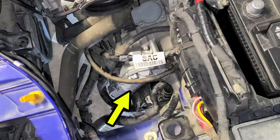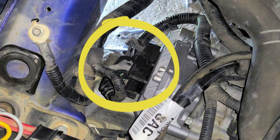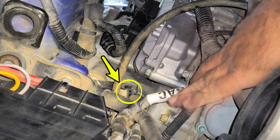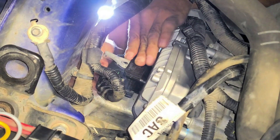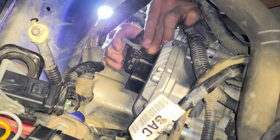Now I have access to the TCM, which is located right here. Circled here are the two wire harness connections that will need to be unplugged from this module. Here's a look at the same connections from the bottom side of the engine. Because this car is very low to the ground, I did go ahead and park it on a set of ramps so I can access the bottom of the engine as well, which makes this job easier. Before unplugging these, there are a couple of spots where the wires will need to be pulled loose as shown here highlighted with the arrows. There are also some tubes at the bottom and top that will need to be pulled loose as well. Each wire harness can be unplugged by pressing a small tab circled in yellow, then pulling on the handle which unlocks the harness. Since these are rather big, they can take quite a bit of force to remove them, so wiggle the plug while pulling at the same time.